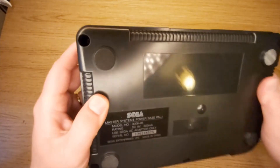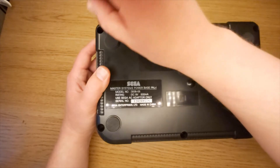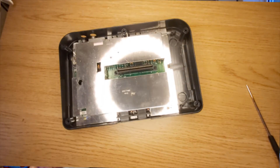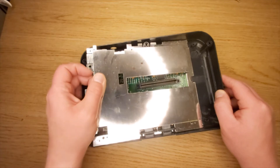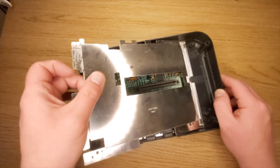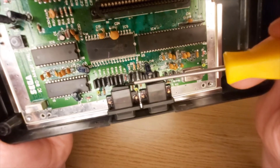Here's the console. To get into it, just turn it over and you've got about five screws around the edge that need unscrewing to take the top off. Once you've taken the screws out, lift the top off nice and easily, and you'll be confronted with a metal plate securing the circuit board underneath. There are about six screws holding it down around the edge. There is a little lip on the right hand side you need to lift up and pull away - it was a bit awkward, but take your time. Once you manage to take it off, the circuit board is exposed.